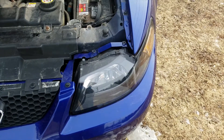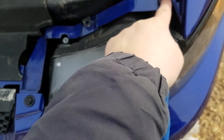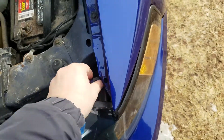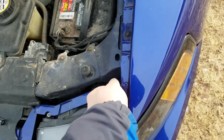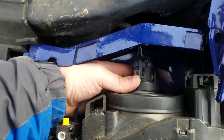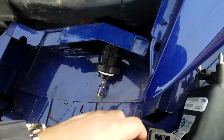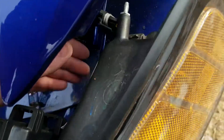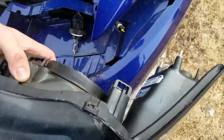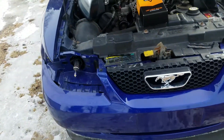What you're first going to need to do is take out the headlight in order to get these light bulbs into place. There are two tabs right here that you need to pull out — one right here and one right here. Got both tabs out, headlight should slide right out, and you just gotta twist this guy out. Boom, got access to the halogen bulb. Twist this little guy out and boom, you got the whole headlight assembly taken out.